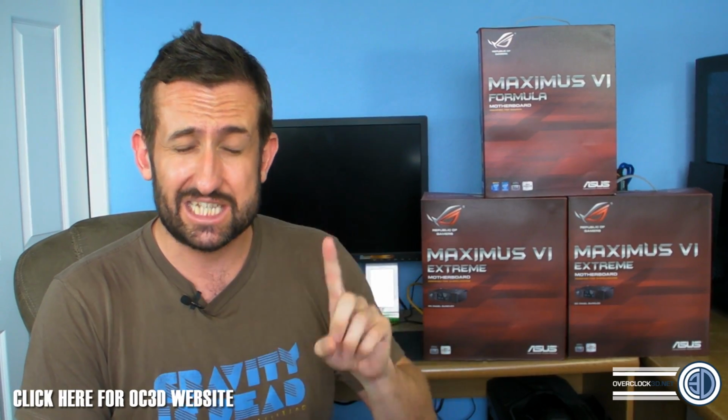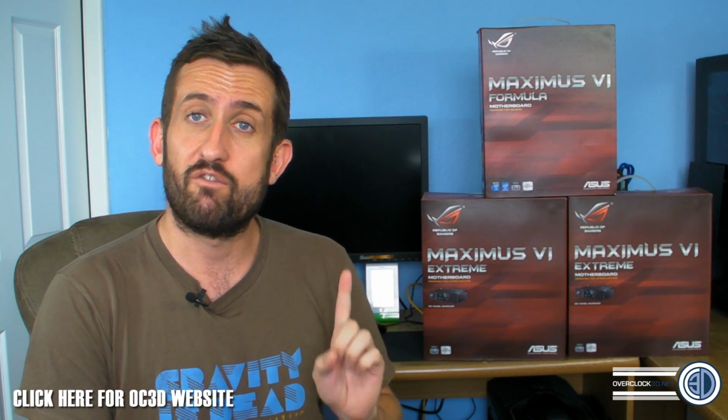I've spoken to retailers, and they're going through hundreds of CPUs just to get a handful that will do 4.8. So another thing I'll say here: if any of the retailers worldwide are speed binning and selling you CPUs that will do guaranteed overclocks, first things first, that's brilliant because you know it's capable. But the thing you need to always remember to ask is, what voltage does it require to be stable at that overclock? 1.26 to 1.3 is a sweet spot. You start going above that point and you are going to need some seriously good cooling to keep that thing in check.